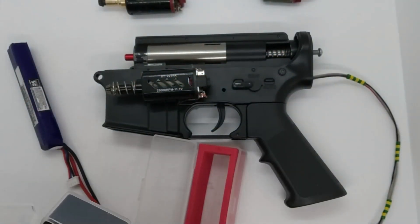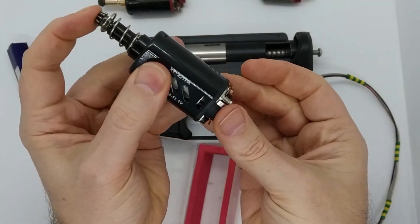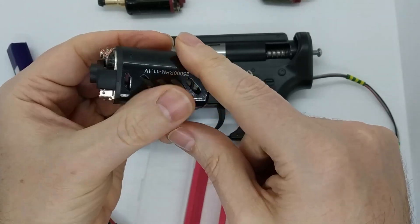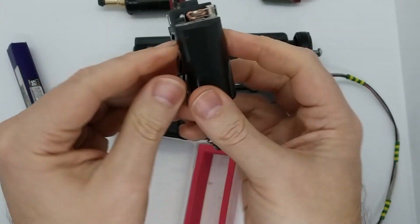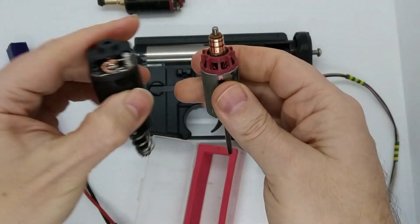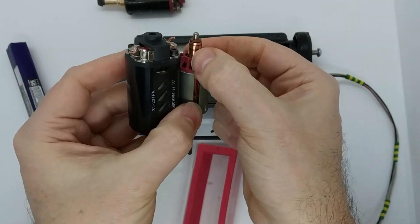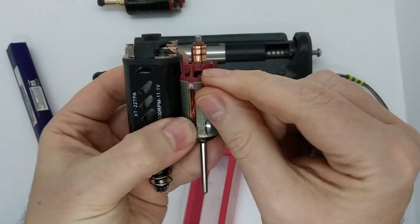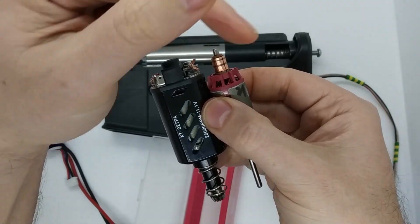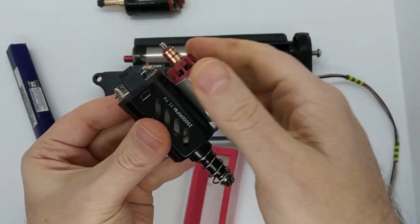These new ones from XT all seem to be really well shimmed — there's no movement at all. What you may have noticed is this little hole up here, one there and one there. If you look at the armature, you can see there's a little plastic fan that sits around the top, just underneath where the tabs are. Presumably it creates a bit of a fan effect on the top as it spins around — you can see it spinning there.